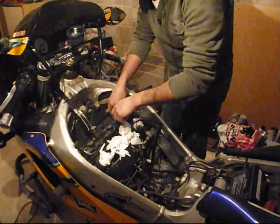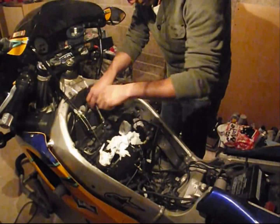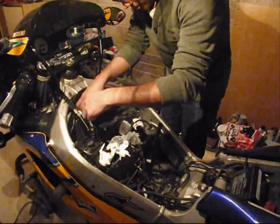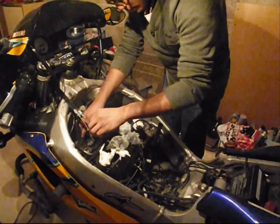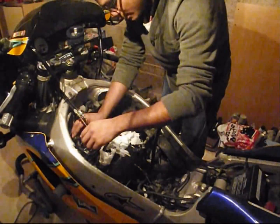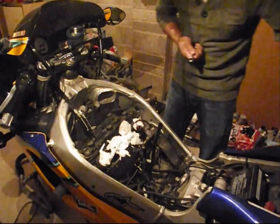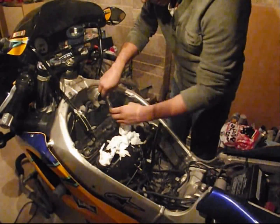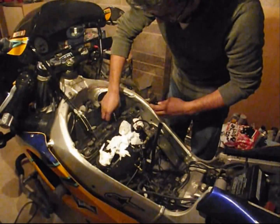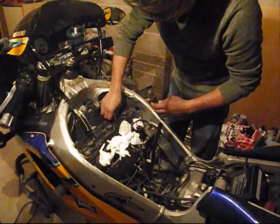and you feel for it. Crack. Crack. Home. Crack. Drop it in gently. Let it settle. Home. And crack. And then you can just get rid of the actual ratchet. Again, let it home. You'll feel it. Unwind it. It should come out easily, unless you've cross-threaded it the last time you put your spark plugs in.